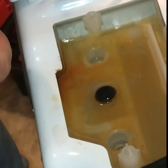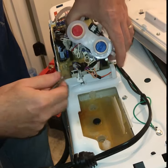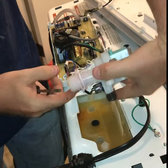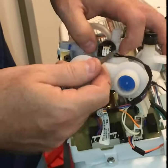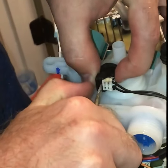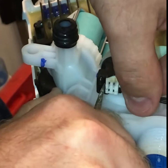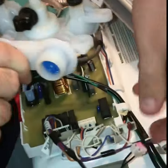This gasket is the culprit - it's the leaker, and it's got rust on it so it's been leaking for at least a few weeks. Now that the valve is off, from underneath you can see there's another wiring harness. To get it out you need a flathead screwdriver - pry up on the little black prong there and the wire should lift out. It might be a little tight at first but it should give.